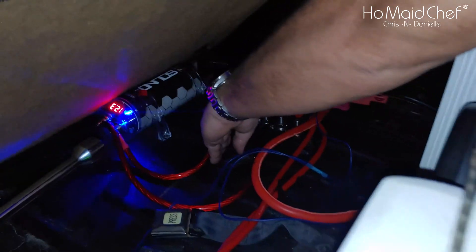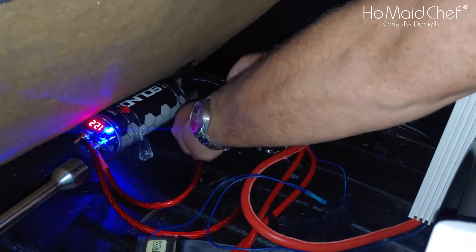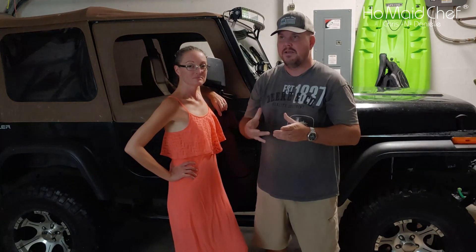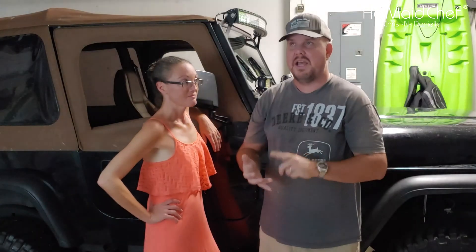We're going to put something on the wire to keep it off the grounds because we don't want it to ground out — this keeps you from blowing your fuse. Using jumper cables for our amp wires worked out perfectly and was cheap, but the 2 gauge wire was a little hard to get into the SCAR amplifier that only accepts 4 gauge wire. We have bus bars at the battery and bus bars for our amp system. We wired our capacitor in and we have two amplifiers — the JL 600 mono and the SCAR 800 mono.